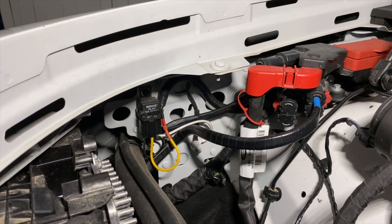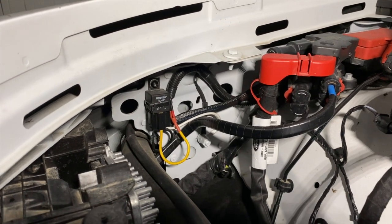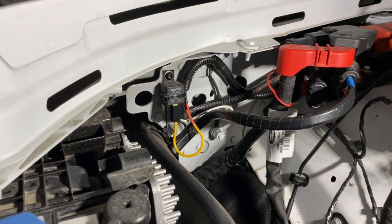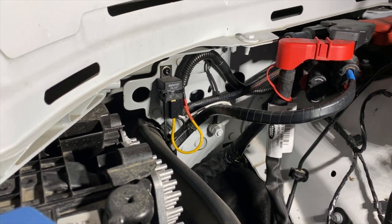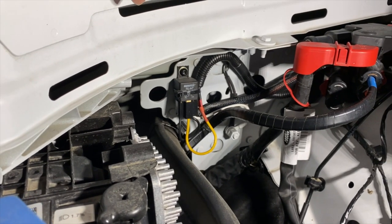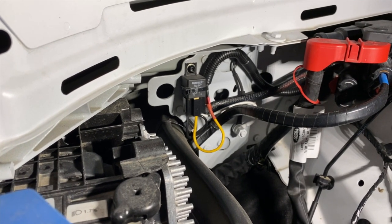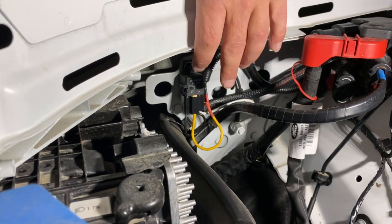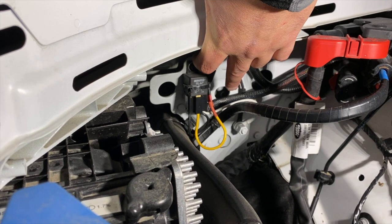What you can see here is I've snugged my relay under there — isn't it nice? I've got another one to put up there because she'll shortly have a laser light bar as well. There's a little nut here holding the relay, and it looks like a perfect spot, but the reality is unless you've got tinkerbell fingers you're never going to get that in there. I ended up using angled pliers to squeeze it in, but the reality is it works when you get it in.